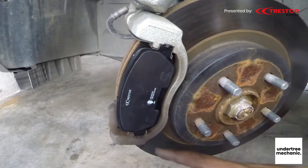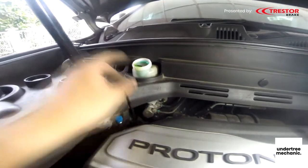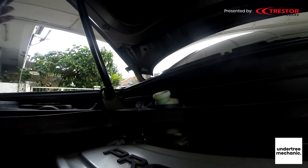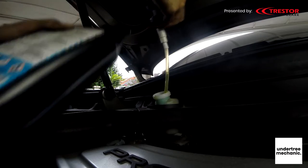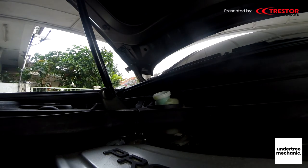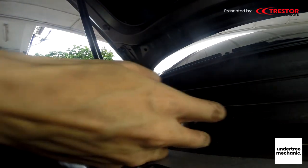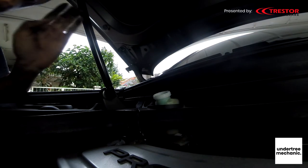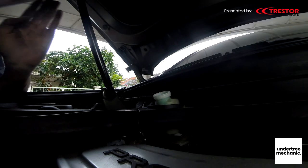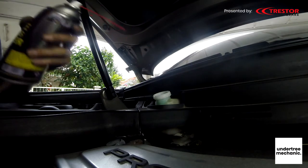Just see which one is flatter, then you go in from the lip first, then slot it into the smaller one. Luckily we took some of it out because now it's overflowing — we still have to take more out. If some of the brake fluid came out, it's very bad for paint so clean it as soon as possible. If you can't reach it, just buy a brake cleaner — it will dissolve it and evaporate very fast.